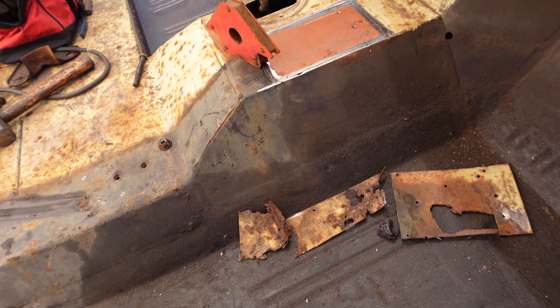Removed the cancer and replaced it with the new panel right there — just a little tab. Luckily this is a 4x4 and this area will be bed liner coated, so it doesn't matter if you get dents and little things here and there. At least the cancer is gone. Now I'm gonna work on grinding the tub so I can tack-weld it in here and I'll be good to go.